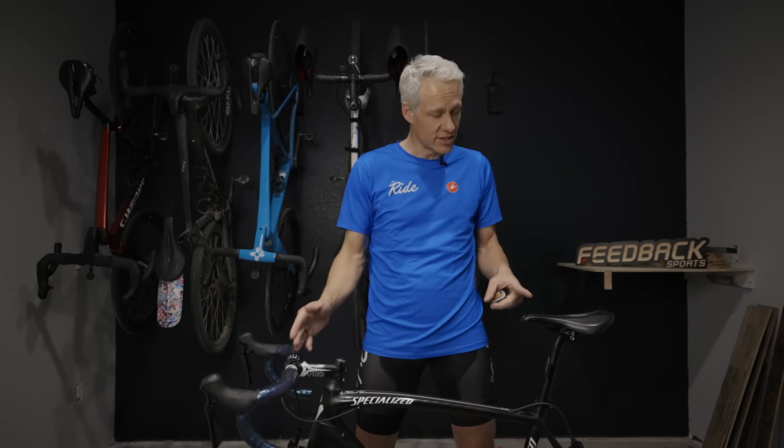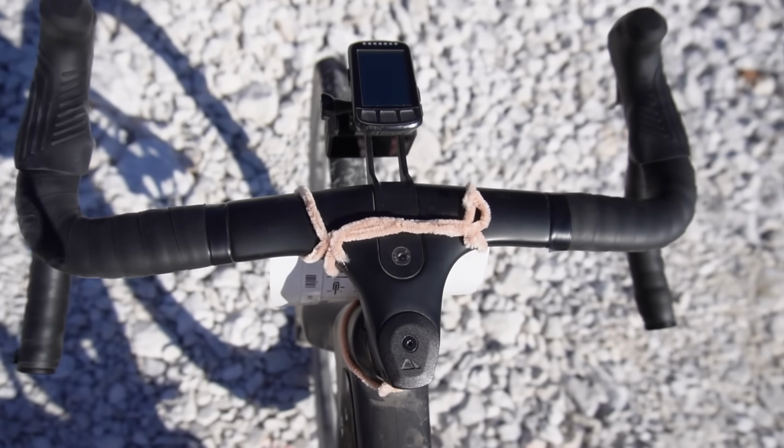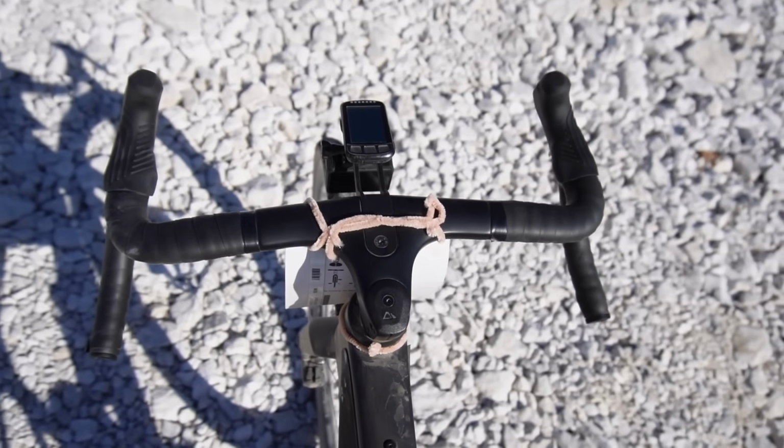On the front end, standardize, standardize, standardize. Always measure to the same spot, but be aware that bar shape and even hood shape can affect your fit. And yes, integrated cockpits look great, but be aware of their limitations. That's very much a measure 3 times, cut once, or in this case, buy once. And lastly, bike fitters and bike shops are your friends when you have questions about what a good fit is and how to adjust a bicycle to fit comfortably for you.